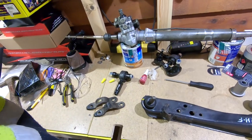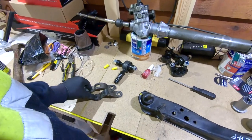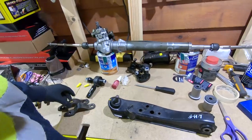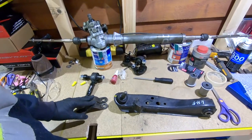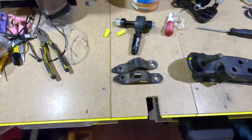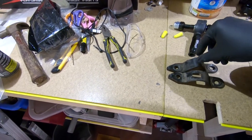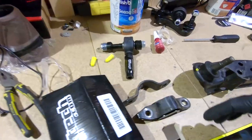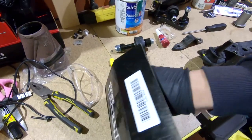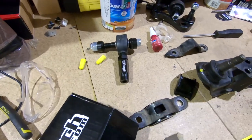Here's something I didn't check after all of that. The crossmember bolts on the Gazelle are M10s. The bolts from an S13 are M12, which means I will have to use the S12 brackets. The only reason I didn't use these to begin with was because these are too wide — the triangle bit, too wide; the circular bit, also too wide.